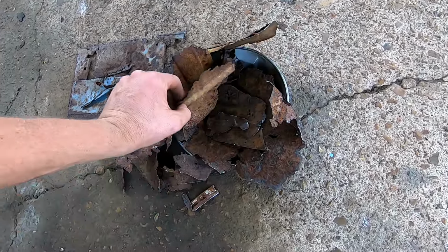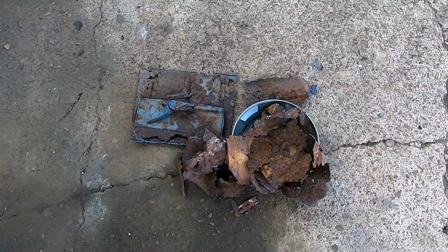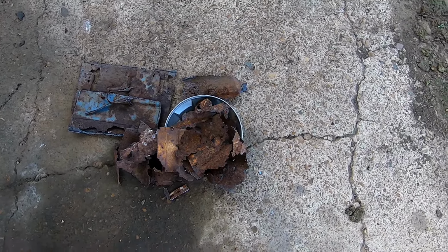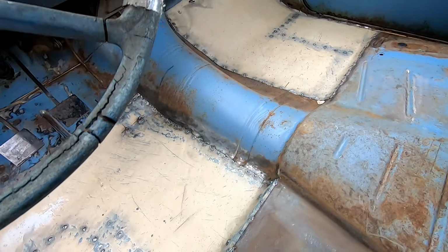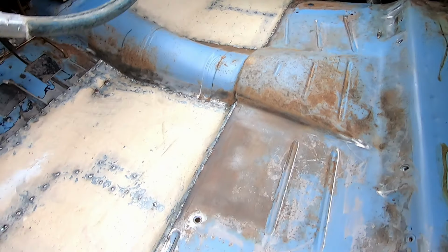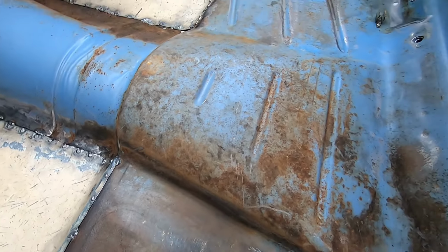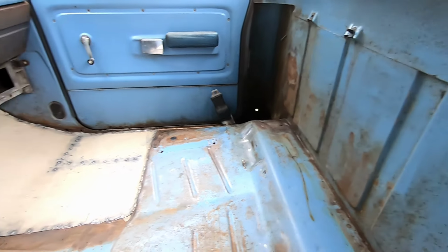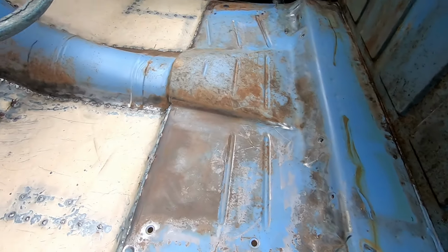And I can't forget the pile that we cut out. It's no longer there. Here's our floors, a little bit of cleanup. I ran over everything with a wire wheel, and you'll see there's still a little bit of ugly, rusty lookingness. That's fine. I wiped it all down with paint thinner, and my next step, I'll do the Permatex rust stop on here. But here's what I got.